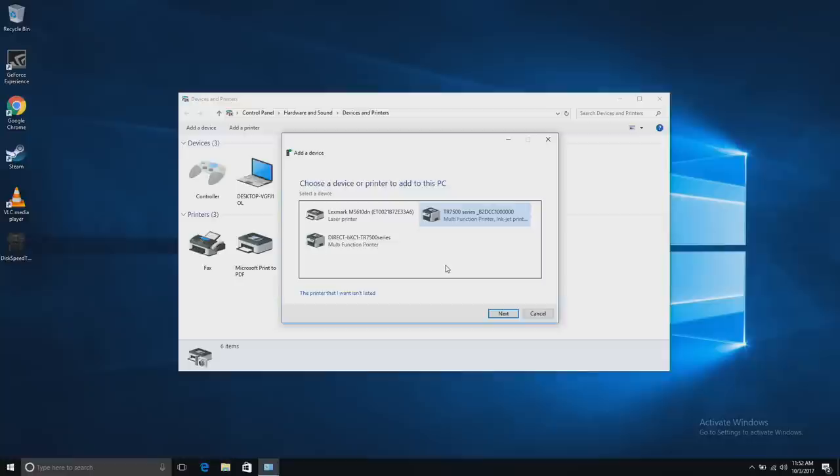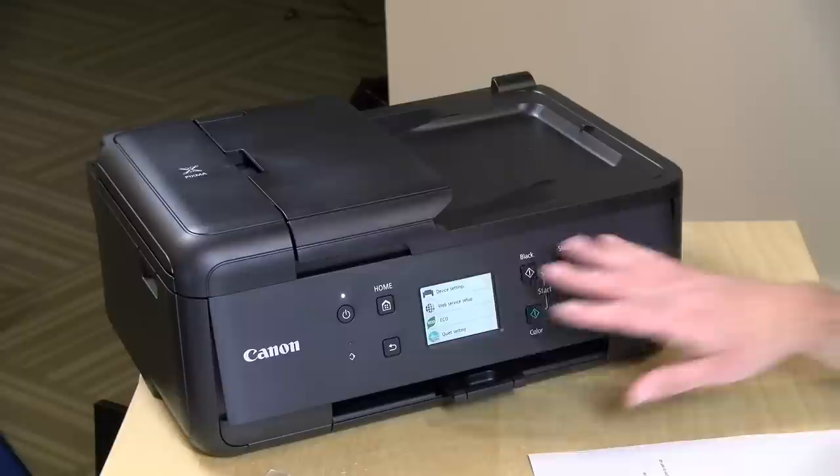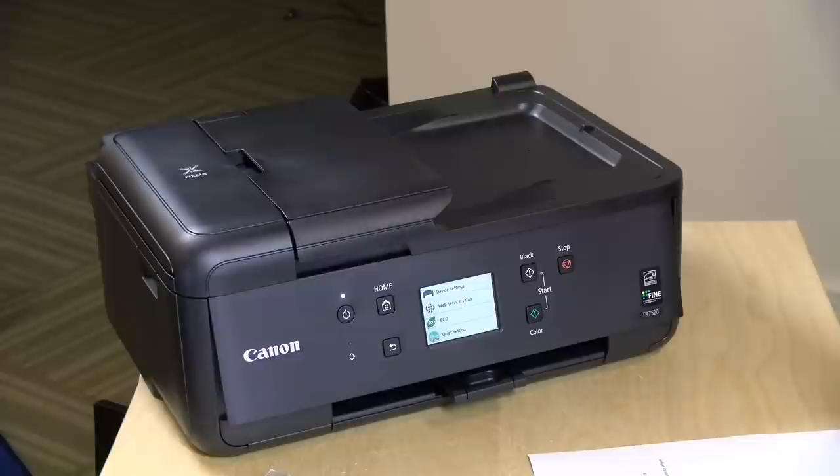It can connect to your computer via USB, but my advice is to connect it via Wi-Fi so all the computers in your house or office will be able to see it. I've got a Windows device here that hasn't yet installed this printer — it's already showing up on its list of printers and pulling down its drivers automatically. One thing I noticed when setting it up was that I had to configure the Wi-Fi through their mobile app on my phone, even though it's got a pretty nice display. I unfortunately could not get it connected to my Wi-Fi network until I used the app, which was a disappointment. But once I got it on my network, everything saw it automatically. My advice: use the app method to get it on your Wi-Fi network, and then all your computers can connect. My experience so far has been that Windows and Mac computers both see this thing automatically and find the appropriate drivers.